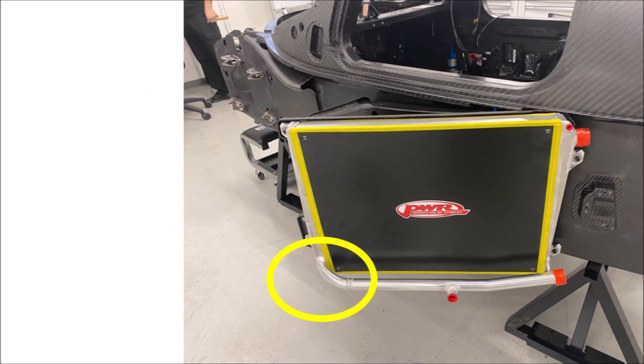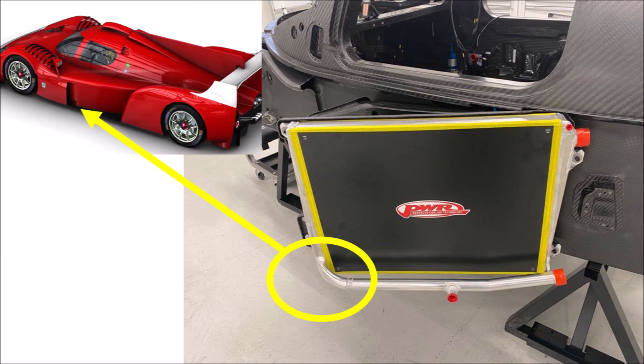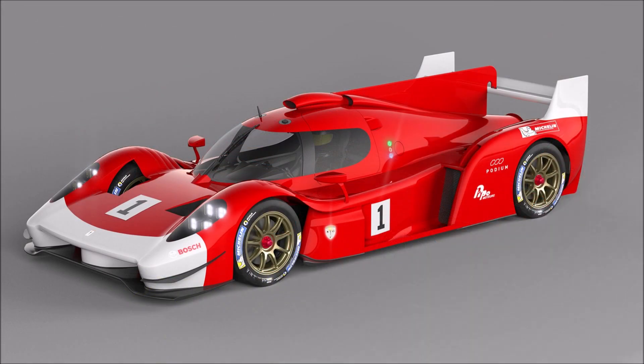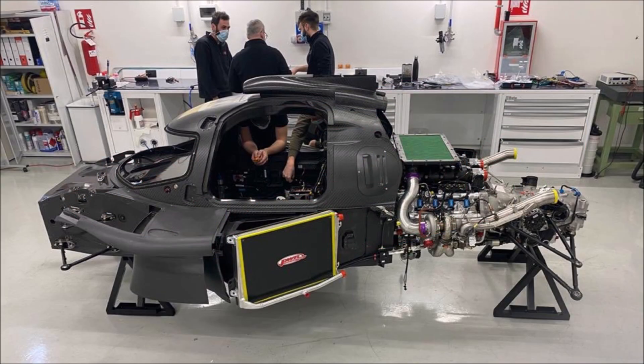The hot water in the intake will be hotter than the air exiting the radiator, so it could already be cooled down a bit before entering the radiator which gives you a bit more cooling. And exactly this radiator connection at the lower outboard corner is limiting the undercut of the bodywork. It seems like they tried to open up the outlet a bit to get more air around the side pod. If we compare this to the Toyota and ByKolles, this flow path is pretty obstructed and there will be less front downforce than the other two. It seems a bit like the priority was the big rear axle inlet to get this coke bottle shape and guide air along the inner side of the rear wheels. Since there is little air coming from the front axle there is a risk that the front wheel wake could be sucked into the rear intake, which would reduce the diffuser performance.